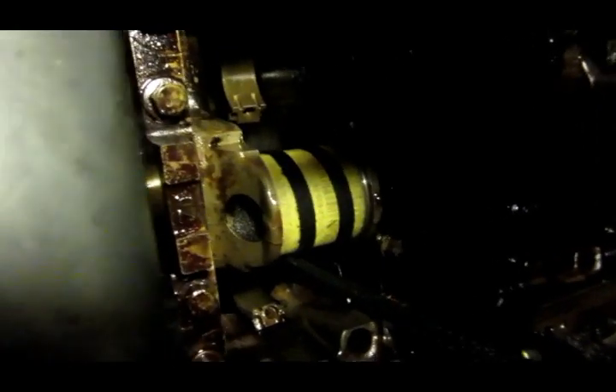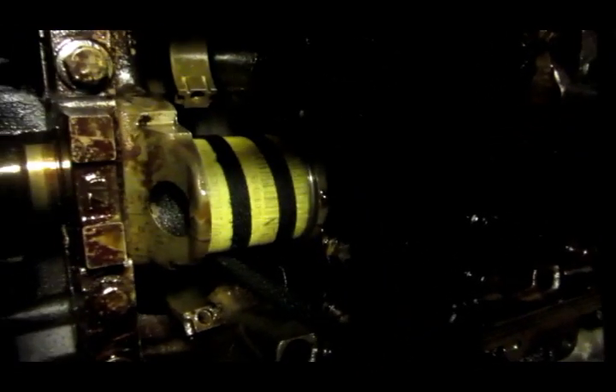When you move it, it goes all the way to one side, and when you pull the other way it goes all the way back. That's how you get the crank polished back up. I'm going to do 400 grit and then 600 grit. This is the very front rod bearing - it's right over the diff. You can see how clean the crank got from using the acid - it just ate all the crap off the crank. The crank's pretty clean up here compared to the back ones.